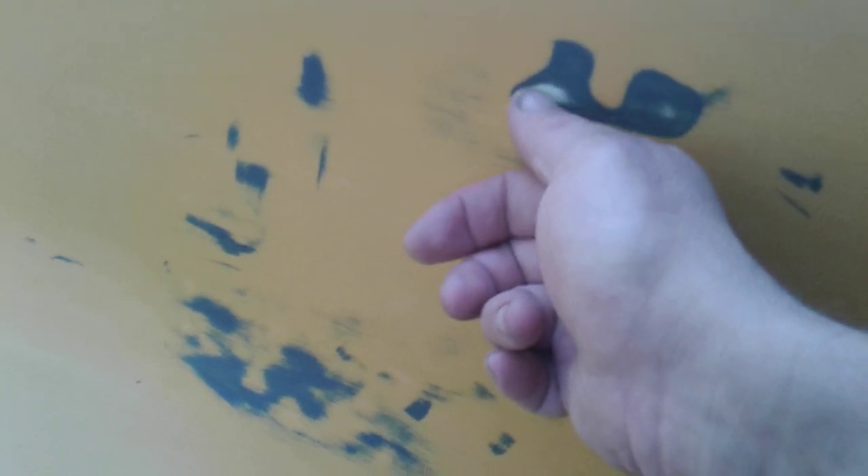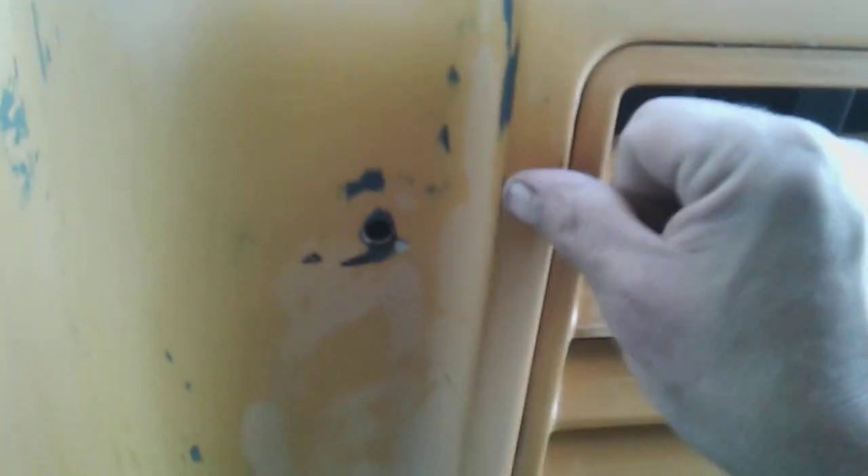You can see I got some sanding going on. What I've been doing is prepping the hood. I told you last video there's a lot of clear coat and it was really thick in this area — I was using 80 grit sandpaper to get it off. I went down to the primer and even a little bit into the fiberglass, but it's very smooth. You can see the clear coat is this white stuff right here. I sanded with 80 grit, then smoothed it and went over with 200 grit and it's actually pretty smooth — I think this would be okay for paint. None of this is going to show up; you can't feel it, it's not going to leave lines.